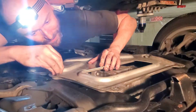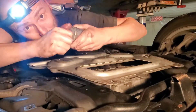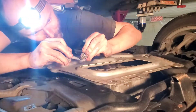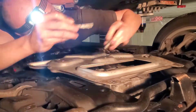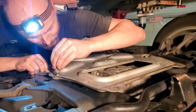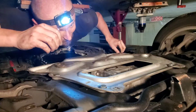You're supposed to replace these bolts every time. I went to BMW and asked to buy these bolts — I went to the dealership and they absolutely refused to sell me them because they said that's ridiculous. The guy at the counter got a technician to come out and he said they never replace them unless they're wrecked. So I'm not going to do that, but I am going to put anti-seize on them because chances are I'm going to be doing this again.